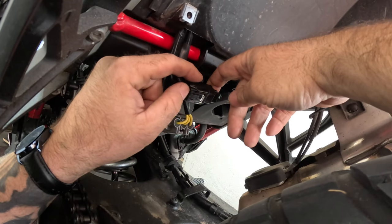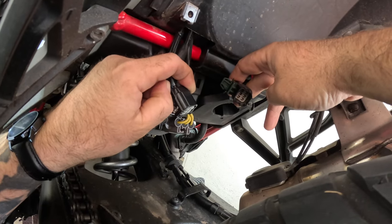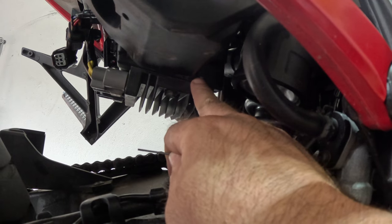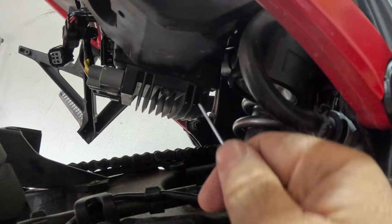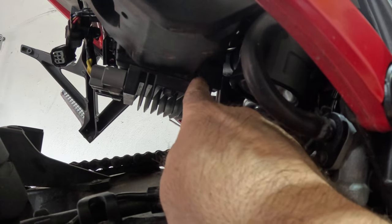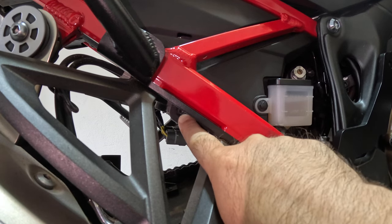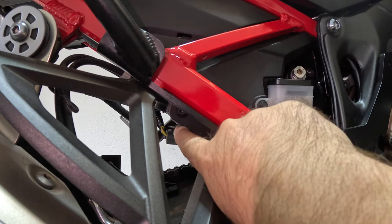On this connector you can see there's a bit of a tab on the end — push that down and then you can separate the two. Next to the rectifier on the exhaust side, just above it, there's another one of those small plastic rivets. Take your Allen key, push in the center, and pull this one out towards you. Go between the exhaust side foot hanger and there is one more bolt here to undo, and that should allow you to wiggle out the exhaust servo from underneath the bike.